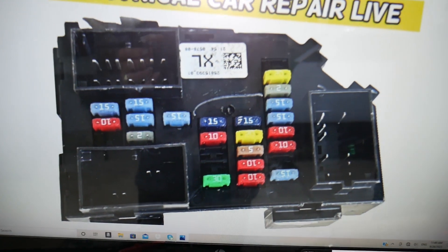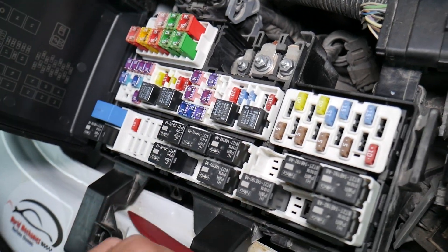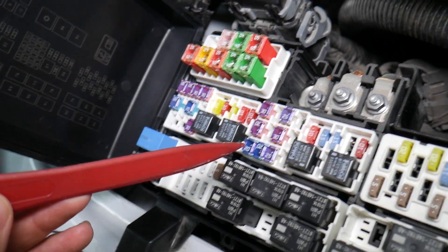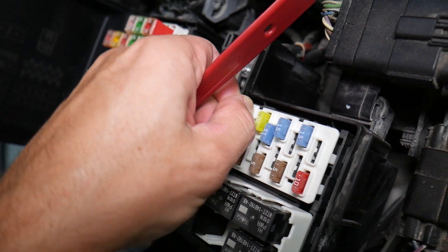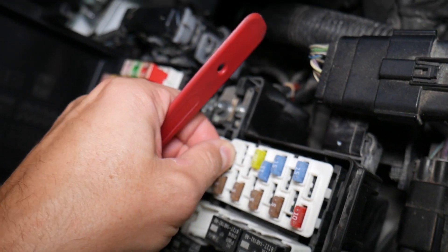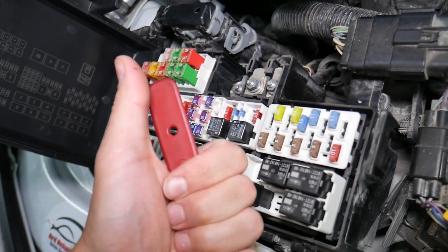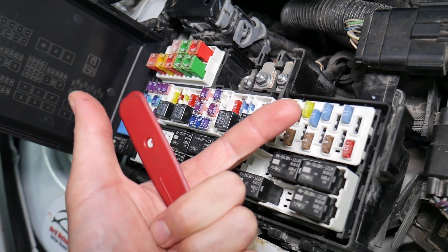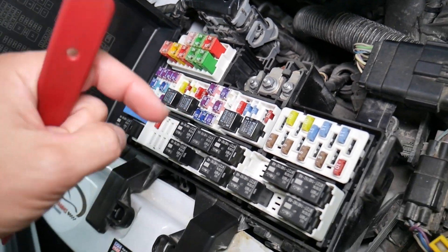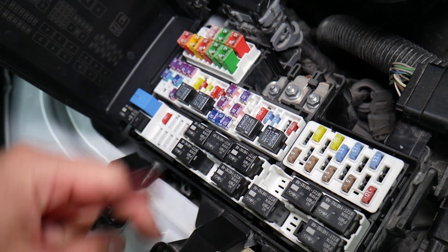Before we continue, let's explain quickly why it's always a good idea to test fuses and relays. It is very important to test them because on those fuses you cannot clearly see if they're burnt or not — especially with mini fuses as well. If you assume that a fuse looks good but it's actually a bad fuse, and you put that bad fuse back in, you could start replacing parts that you don't need to. You'll lose time and money fixing a problem that doesn't exist, when all you have to do is test the fuse and replace it. We'll put a link to a special video that will teach you how to test fuses and check relays very easily — check it out, it will be in the description below.